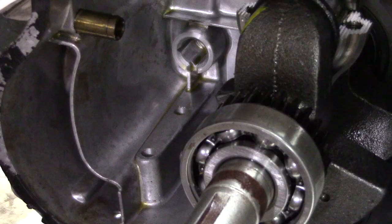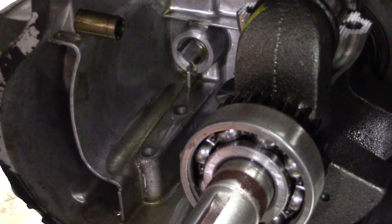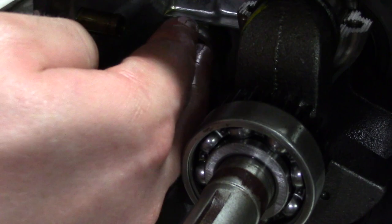The first thing we're looking at here are the lifters. The one on the right is a billet lifter, the one on the left is the stock lifter. These things are pushed up and down by the lobes on the camshaft which indirectly or directly move the valves themselves. So if you're going to get a performance camshaft, make sure you look into getting lifters. I decided to go with billet lifters because they're able to handle the extra spring pressure.